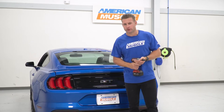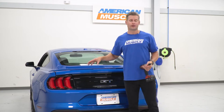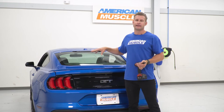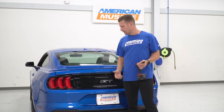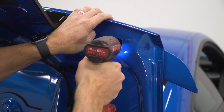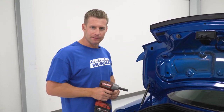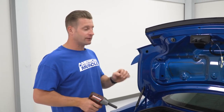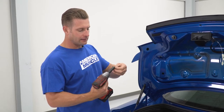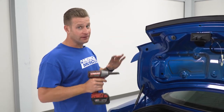For the purposes of this video, for our spoiler install, we're gonna be using our 2019 GT, which does have the factory blade spoiler still installed. Again, if you are doing this install on a spoiler-less deck lid, there will be some drilling involved, but since we're not doing that here, we'll show you how to do the install using a factory deck lid spoiler. Getting started, pop the trunk and locate the four 10-millimeter bolts. A quick tip: since you're using a 10-millimeter deep socket on these nuts, I like to do the tape trick — grab a little piece of painter's tape and insert it in the end of your 10-millimeter deep socket. That way it gives the nut something to snug up to and it won't drop into your trunk lid.